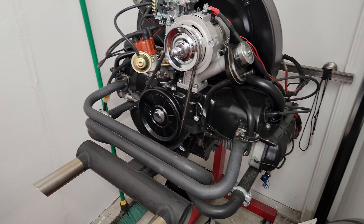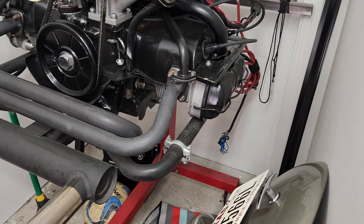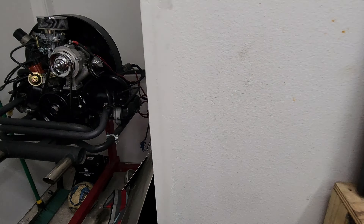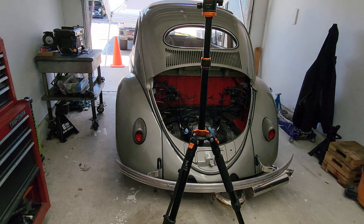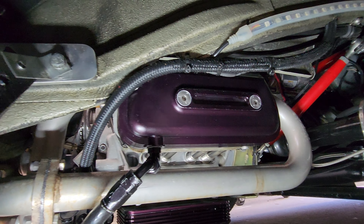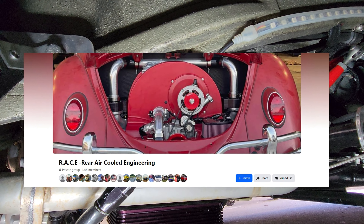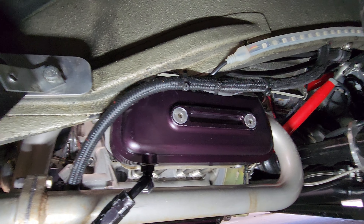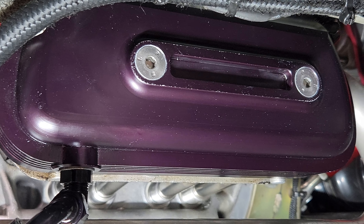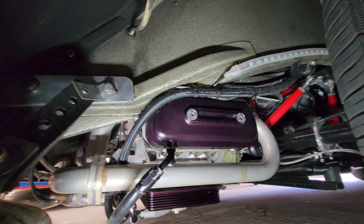The 40 HP is still hanging out over here in the corner. She's got a little leak from the oil cooler - I picked up a new oil cooler and we'll be replacing that eventually. The bales on the cylinder heads maintain constant pressure on those valve covers, which I don't have that option on Goose. If you're new to the channel, you haven't seen this cool bling made by Daryl Howard - check out his Facebook group, Race Air Cooled Engineering. After a certain amount of time, the bolts don't maintain constant pressure against the valve cover like bales do, so it starts to leak. The silicone gaskets shouldn't have that problem, so we've installed those.